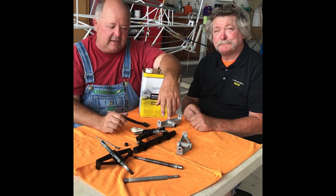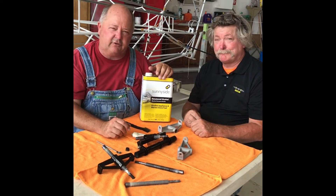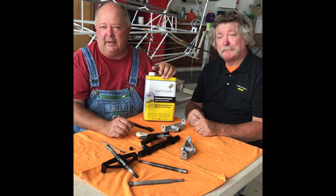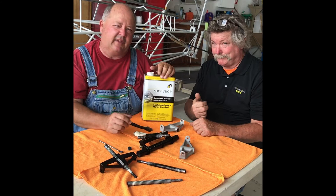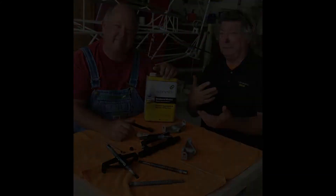You can't trim the airplane until you slow way down or you're on the ground with no pressure on the elevator. That's our little tip for today — just talking about jack screws. On our next video we'll talk about how to replace one in an airplane that's already covered. Thanks for tuning in to Don and Ron.